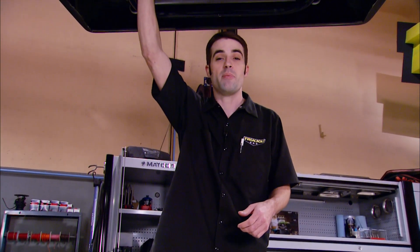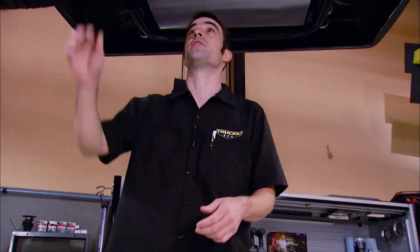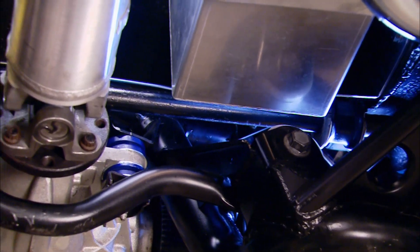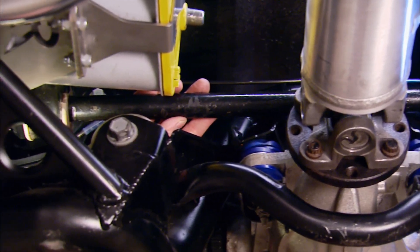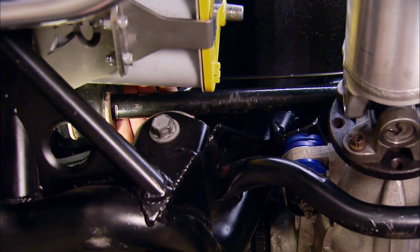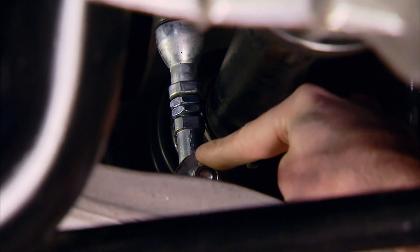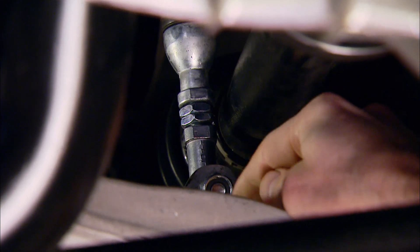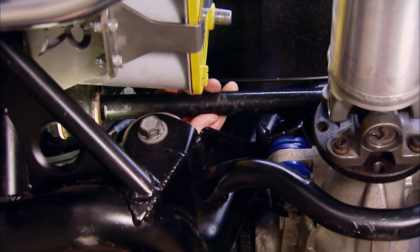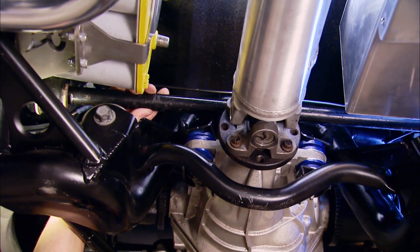The original Cobra independent rear suspension anti-sway bar mounted on the backside of the subframe behind the differential, but it interfered with our coilovers so we had to lose it. What we ended up doing was recycling the truck's original front sway bar, installed on the front side of the differential where there's barely enough room. We made some custom brackets to hang it off the frame and picked up some Posilink end links from Ride Tech, attaching it to the lower control arm's original sway bar mount. This sway bar is a little larger diameter with shorter arms, so it's going to be even more effective than the stock Cobra sway bar at reducing body roll.